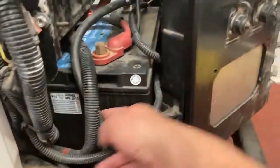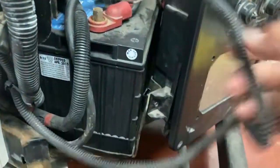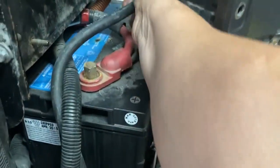For example, we've got two big cables here — one's the battery cable that loops back, and another cable that was used for something. This should all be zip tied down because if it's got a power wire in it and it shorts out, it's going to cause a problem. These cables should be secured so they can't short out.